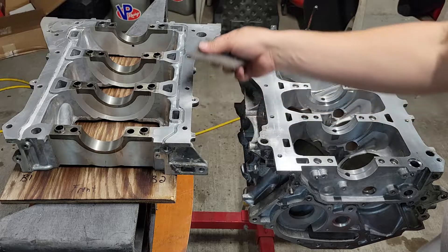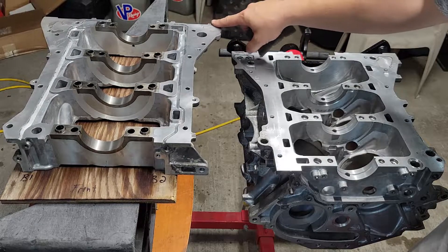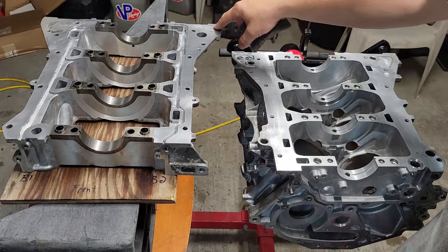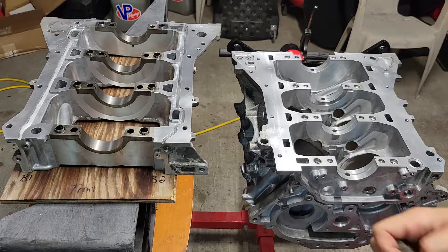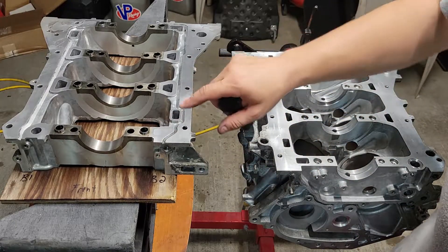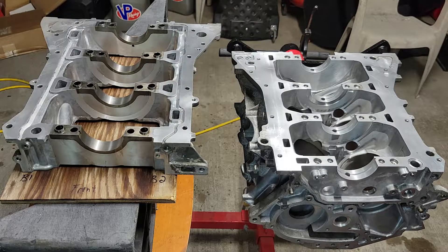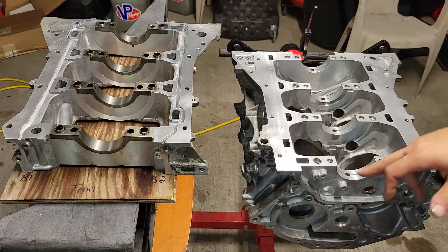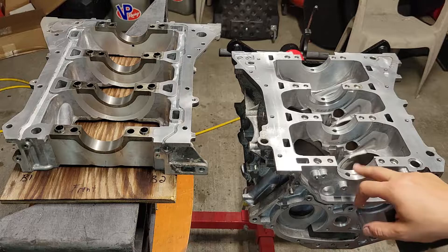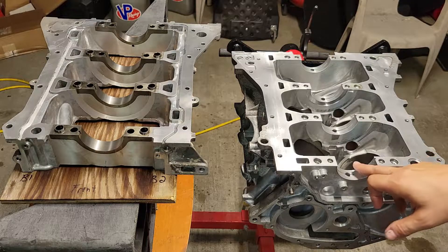Relatively easy with a straight razor. For anything that's left, you can use ultrafine Scotch-Brite. You don't want to put a lot of pressure — just real light pressure. You'll see some oxidation here and there on the edges of the aluminum; I wouldn't worry about that too much, just kind of smooth it out a little. Don't try to scrub hard down on it — you'll start making low spots, and when you torque all this back down you can twist the main bores.